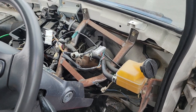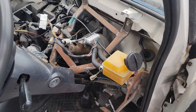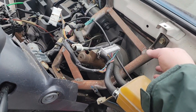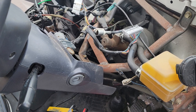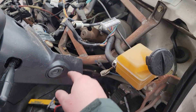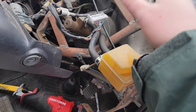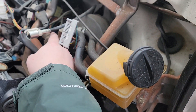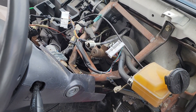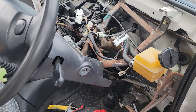One of the problems I'm facing is I want to cut this cabin as far down as I can go, but right here we have support brackets for the steering wheel and steering column. I'll probably still cut these off and weld something in place that'll go to the frame down here, cutting right above where I support it, and try to avoid the booster here. It's gonna be a lot of fabrication, but hopefully it'll come out good.